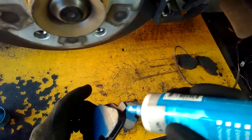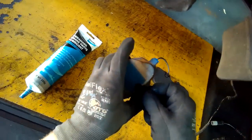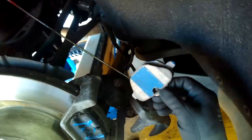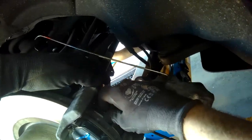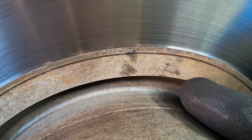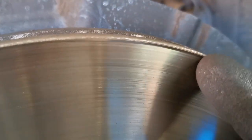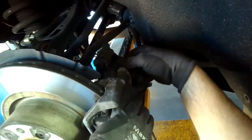I lube the top and bottom of the pads and also the backside of the pads where the piston and caliper hold them in position, to prevent any friction noises that may occur. Because the customer didn't want any rotor work done, I also chamfer down the edges of the pads to stop that direct new-pad-to-lip contact on the inner and outer edges. It's a little tip that can also stop early squeaking on your brake pad installation.